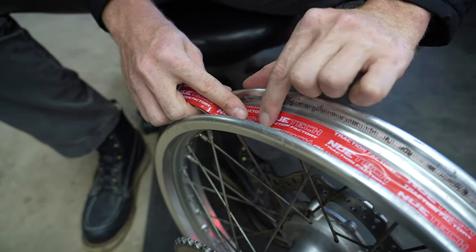Get it cleaned up and get rid of that silicone grease — a lot of people use Armor All. It was a little more difficult than a normal tube install just because of that drop center issue. For a DOT tire the Tusk D-Sport was just flexible enough, so it wasn't that bad overall. Don't forget to torque your rim lock down and back your valve stem nut out to the cap — you never want it tightened down, you want a little bit of wiggle room. I'm going to leave it overnight and see if it holds pressure.